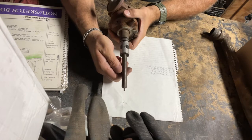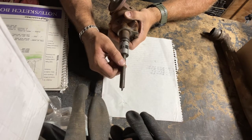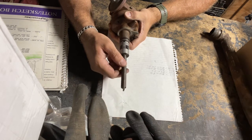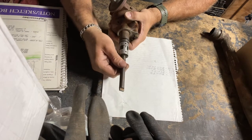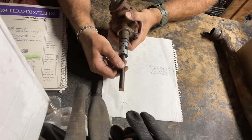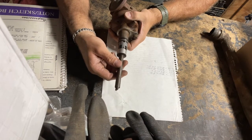What I want to show you is — I'm going to hold the distributor body still and watch how much slop there is. That translates to the end here — probably about a quarter of an inch to three-eighths of an inch of slop on this coupler. And if I go to this coupler right here, there's less — maybe an eighth to three-sixteenths. I'm not sure if this is normal for a points distributor like this.